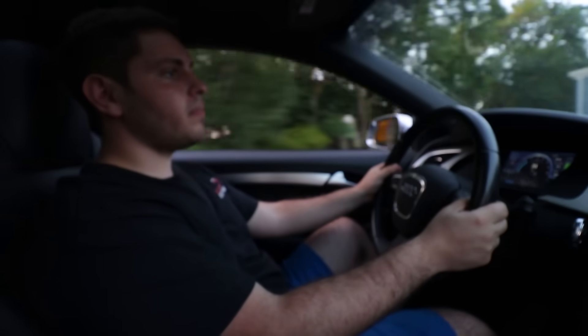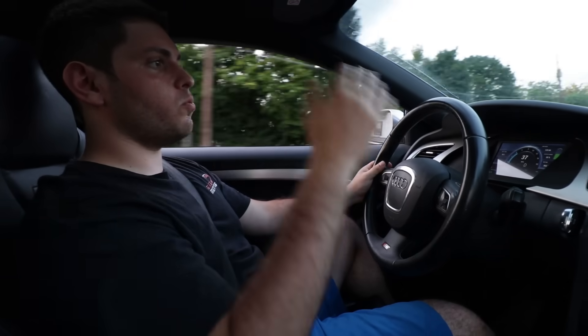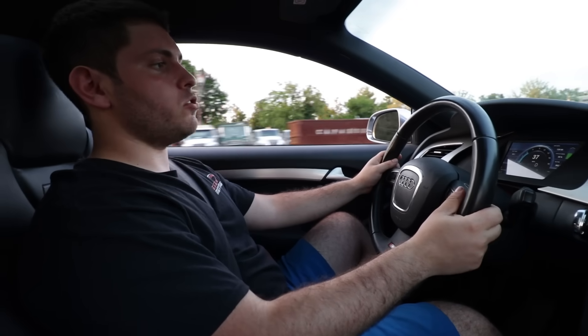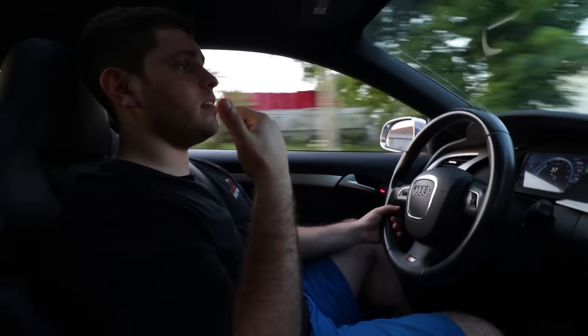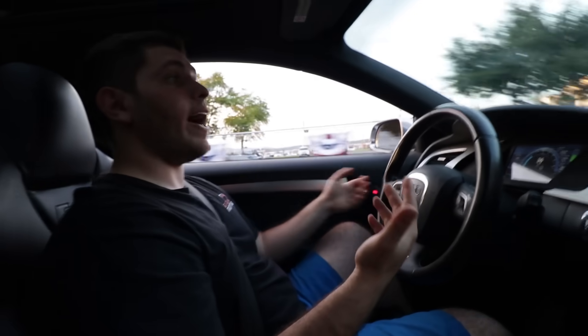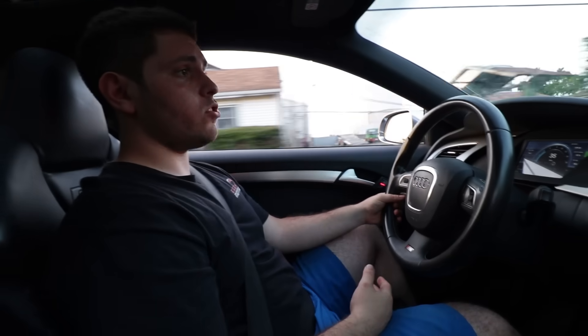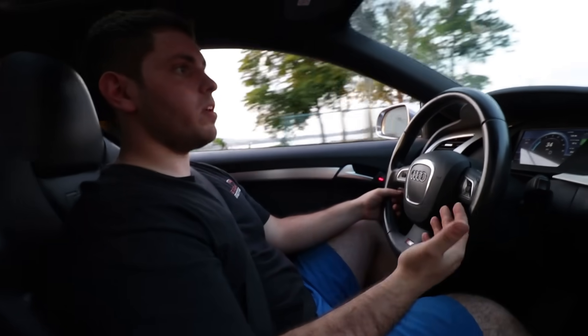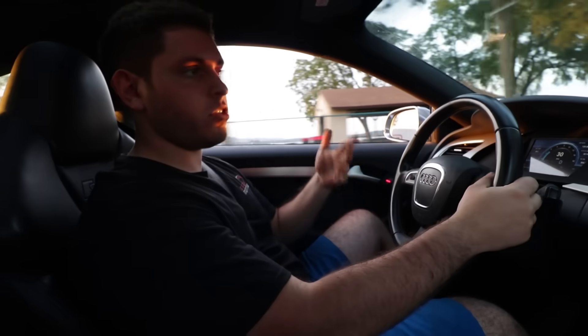How long is the battery life on these batteries? They're rated by cycles — fully charging and discharging is one cycle. These batteries usually last around 1,200 cycles if you fully charge and discharge them. But if you charge to 70% and discharge to 30%, that's not a full cycle. If you do it from 80% down to 30%, it'll last maybe tens of thousands of cycles. They could well outlive their usefulness — meaning in five or ten years there's a better battery, and these still might be okay, but you'd want to upgrade anyway.